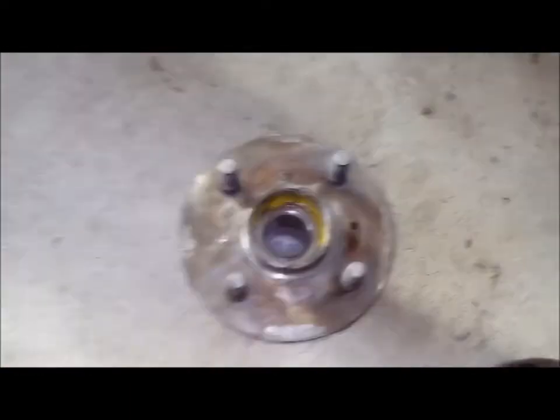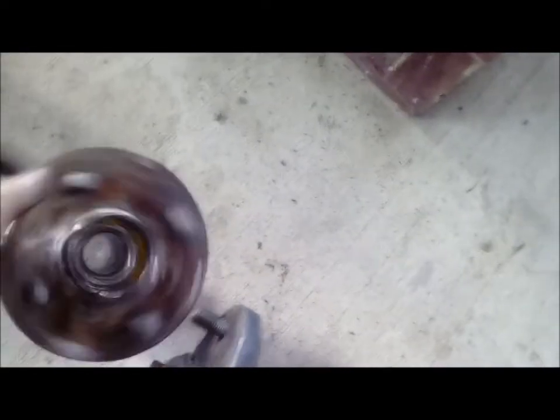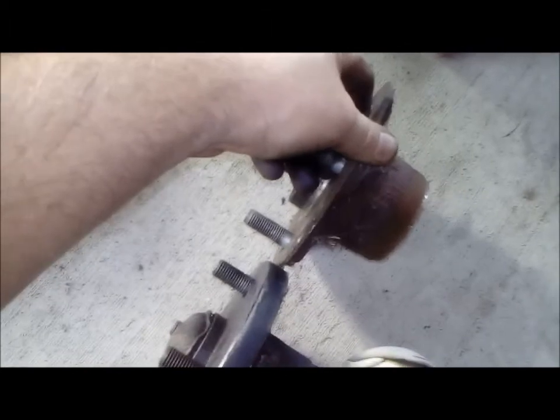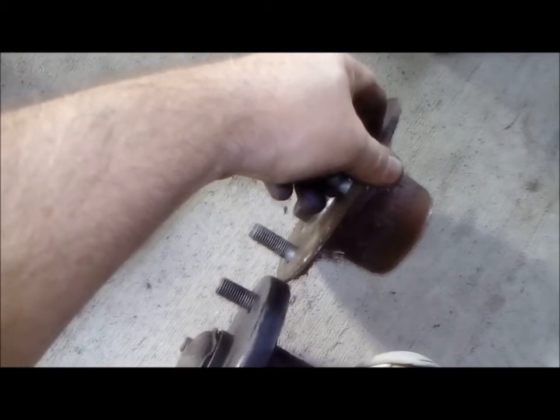I did think about using these studs in this, but I'm putting them pretty much close together — they're about the same length, so I'll stay with the stock ones and if I have to change to longer ones I will. This difference in thickness will push your wheel out a little bit further — a good maybe 5mm — so I might need to do some guard rolling a little further. We'll see when we get to it.